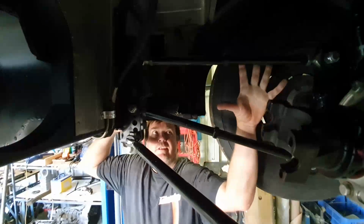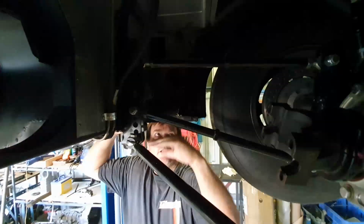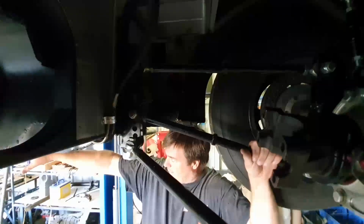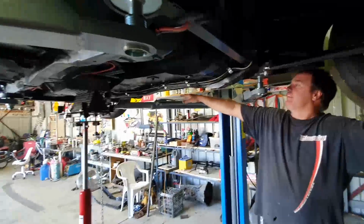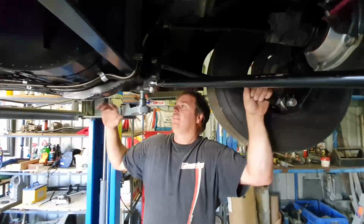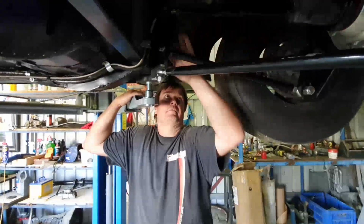So on a slick car you would have it long and low, so this bar would be pretty level and the top bar would be facing down, and long and low would be spindle height of the front wheel, so well below the instant center, well below that camshaft height. So that will pick the front end up, transfer weight to your slicks, and that's just basically how a slick car would work. So this is the complete opposite.